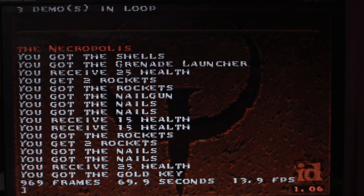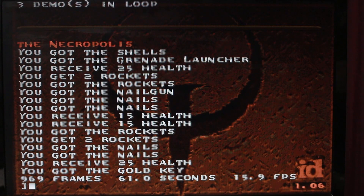It's time to crank up the frontside bus speed. First I'll try to get everything stable at 40 MHz and see if we can get anywhere near our record. I managed to get 15.9 frames per second — a long way from our channel record of 16.8. This is 40 MHz frontside bus which, with the 4x multiplier, means 160 MHz. I've had to clock the cache timings back to 3-1-1-1 instead of 2-1-1-1, so I'm going to fiddle with more settings to see if I can get that back up.